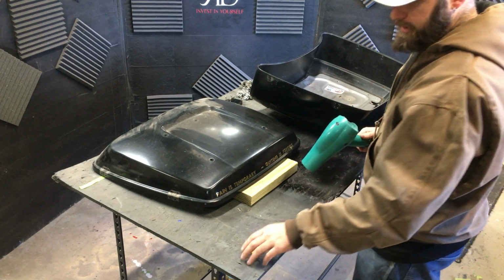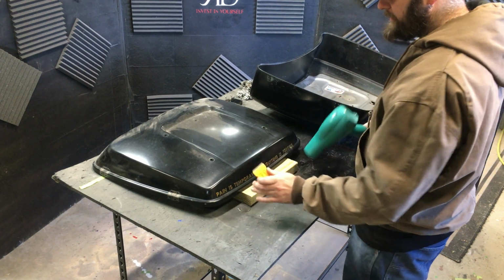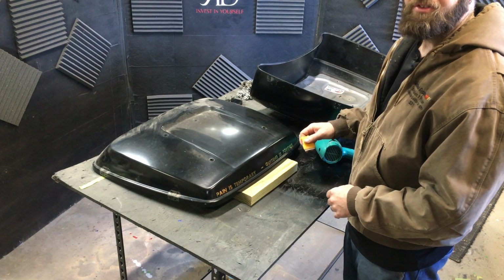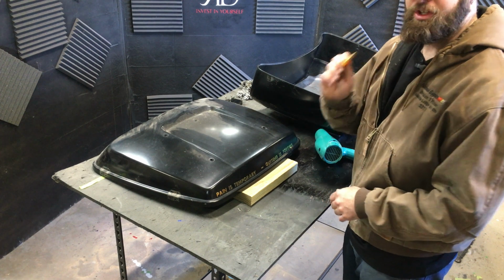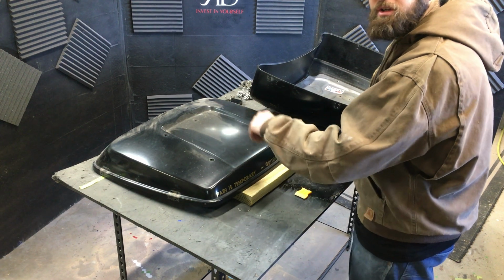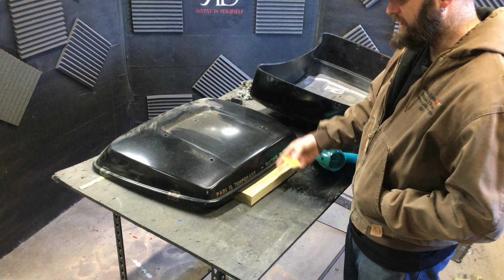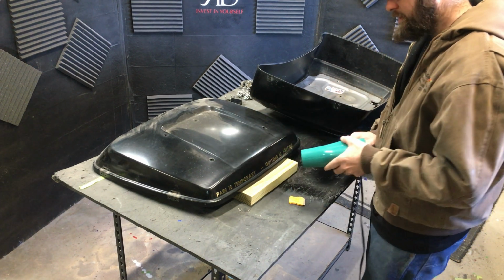Alright, in order to remove vinyl decals, a lot of times all you got to do is apply some heat. This is a metal razor blade. I wouldn't recommend this if you don't plan on doing any other body work. If you're just planning on peeling it back and painting it right after you've scuffed it and you don't want to have to do any body work, I'd use a plastic razor knife. I'll put a link to those in the description, and you do the exact same thing. You'd run heat on it and use a plastic one, and that's a lot more delicate. I'm pretty good with the metal one, so I shouldn't do anything, but if I do, I'm okay with having to do a few little things here and there anyways. So that's what I'm going to do.